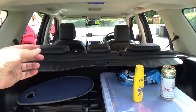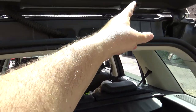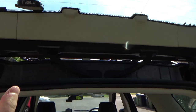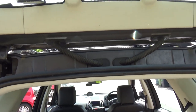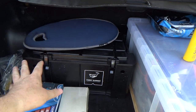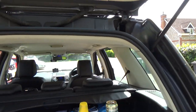So those cables that feed the wiper probably come up and through the roof of the car, above the headlining, and then up one of these ducts here, and then round to the motor. Okay, so the fuse I would expect to be at the other end of the car. It's just in case one of these wires did chafe through and short out, it would be a bit silly to bring the power all the way to the boot and then have the fuse. The relay can be here. It makes sense to put the relay fairly close to the motor. But the fuse is somewhere else, and we'll try and find that and see.